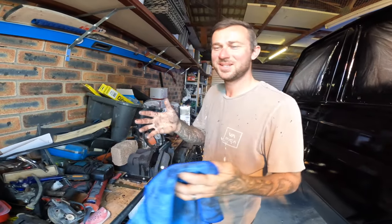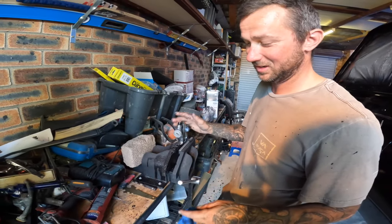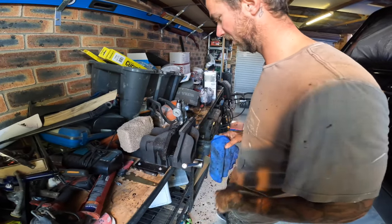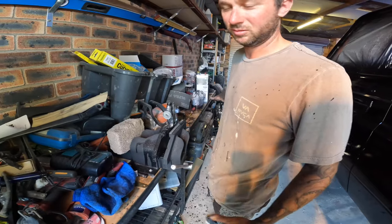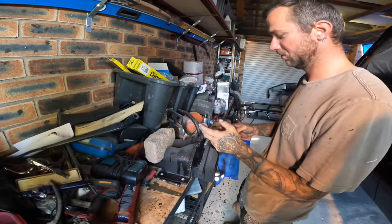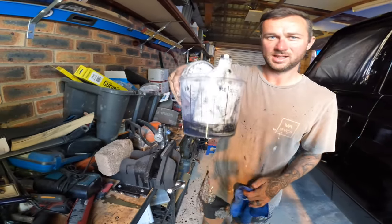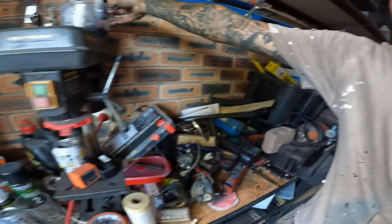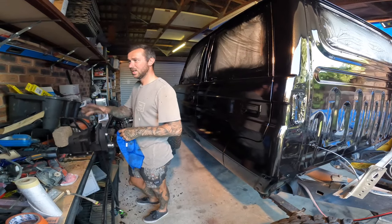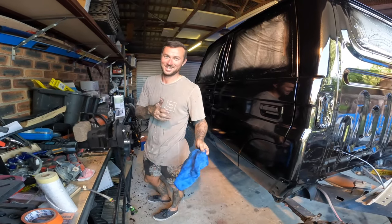Welcome to my shit show — this is what happens every time I do some job. Tip with the paint guns which I've now realised: if you look here, that is all primer and it wasn't spraying a good even coat. So what I'm doing now — I run reducer through my guns at the end to clear them out, but it wasn't clearing properly. So I've put it in a vise, disconnected everything, taken out the nozzle, the pin, the spring, the filter — absolutely everything. I've got my reducer and I'm going to let it sit in a tub of reducer overnight so it cleanses itself properly. That way hopefully when I come back tomorrow the gun is nice and clear, and next time I go to spray I won't have problems like I did today.